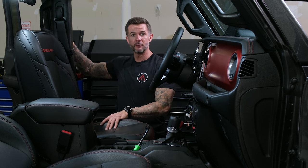Seat's out. Let's go ahead and pull this panel down — it just pops right down. Make sure all the little white clips stayed in. We're going to want to pull all this carpeting up because our amp is going to mount right here. We need access to this path for cable routing. Let's go ahead and pull out the mud guard and remove the trim panels along the side. We'll also need to remove the trim panels in the rear because we are going to install an 8-inch sub in the back seat area.